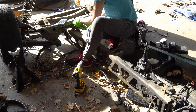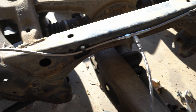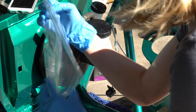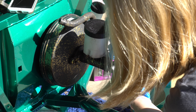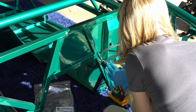From here you can connect that line and just kind of see where it's going to flow along the frame. For reference, this is the rear passenger side brake line, the middle connector over to the driver's side rear brake. We're going to run this up along the I-beam — it's going to share a connecting point with the wiring loom, so you can just use one drilling mount location for those. You're going to run that brake line up into the engine bay, and we're actually going to connect that later to the brake master cylinder. So at this point I've got the front driver's side brake line set up. You can see it connected to the front of the master cylinder here. Once I twist that connector back in the right direction, you can swing that over here and connect it down to this position, and it's going to loop back toward the driver's side wheel.